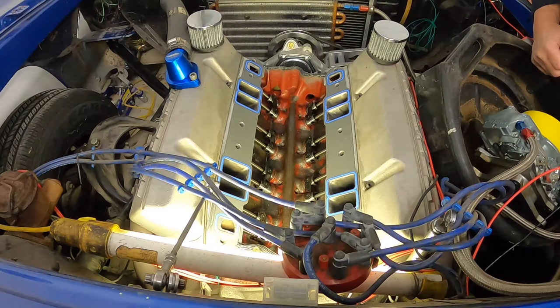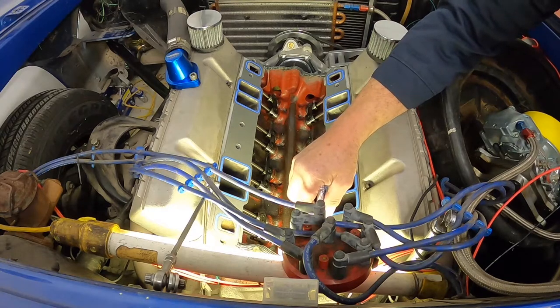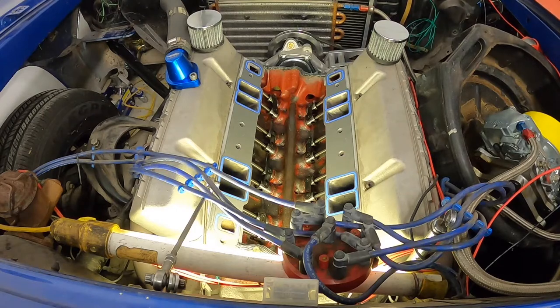So we just sit and wait then, right? Yeah, I just wait a little bit. If it was 100 degrees out, I would be in a little more hurry. See, there's nothing really to hold them, those cork gaskets. And I've seen them split too. That's one thing good about the silicone sealers: with age, they just stay the same. They don't move, they don't shrink or swell or nothing.